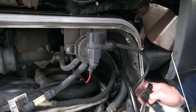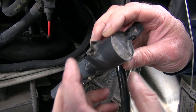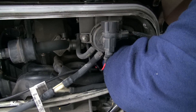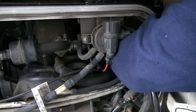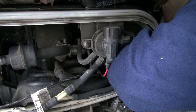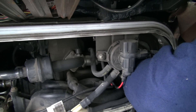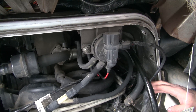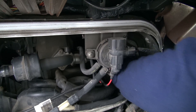Now we're going to take our coil and stick it back down in there. You can see — I actually break that off, it'll break where the bolt goes in. So the main thing is if you get it on the plug and then plug it back in — electrical connection. The electrical connection, you have to pinch the connector to release it. It's hard on the old man's arms — kind of hard to line up that terminal connector.